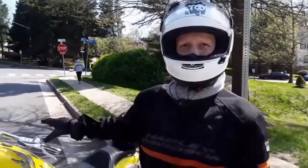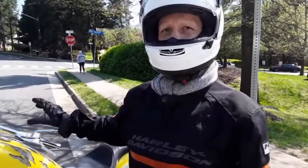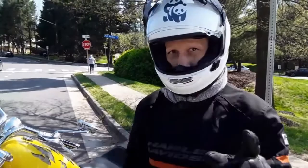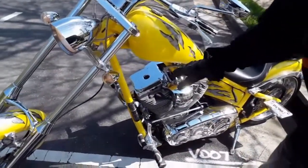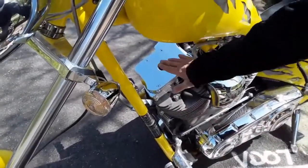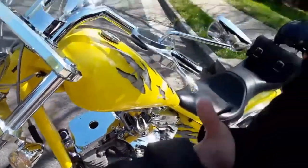We're going to take this out for a warm-up — about 20 minutes on the highway, get the gears shifting and get the RPMs up. Two things before I ride: I let it warm up for at least two minutes, and these cylinder tops should be at least warm to the touch. That's how I know the bike's warmed up.